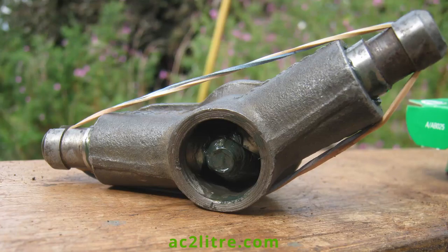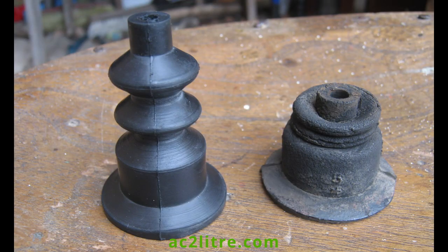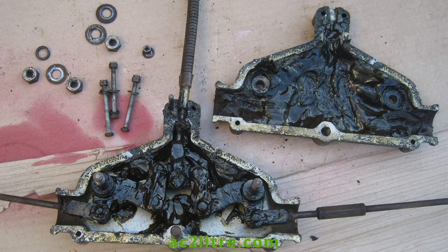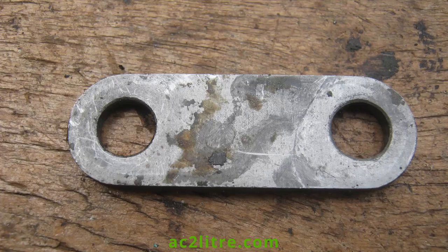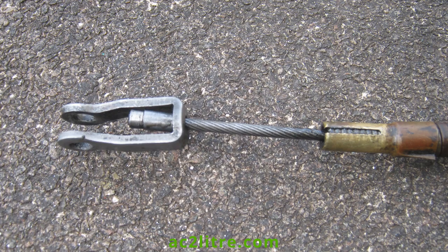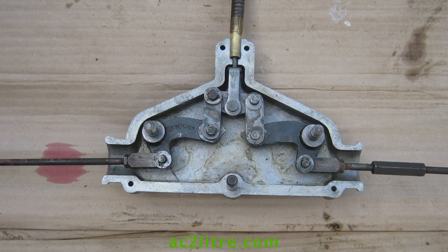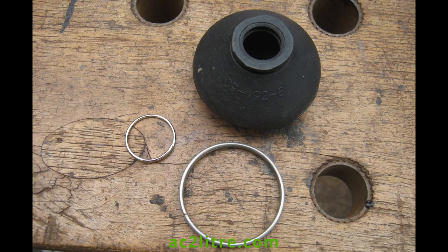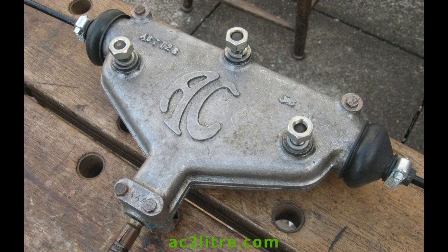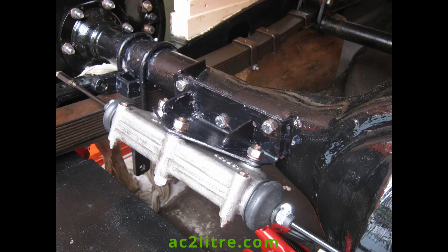Paul Beck Vintage Supplies sell the replacement rubber gaiters. Next on the agenda, the AC compensator that balances the rear brakes. This doesn't seem to wear out, so you just need to dismantle, clean out the old congealed grease and then apply lots of fresh chassis grease. Use new split pins on the clevis pins. The rubber gaiters were missing and I couldn't find anything suitable, so I bought rubber boots that were for commercial vehicle track rod ends. The small holes were too big, so I placed some fuel hose over the rods and used hose clips to stop them from slipping.